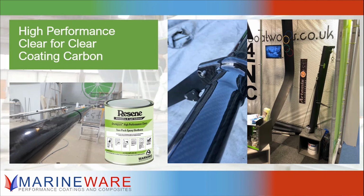I used to use that mixture of clear and primer to come up with a satin, but we now have a flattening agent for the clear coat itself. Have you used that, Pete? No. Oh, okay. It's the Ace Matte, which is a powdered flattening agent. We can mix it into the Durepox clear, and it's completely designed for clear coat flattening. It's very specific for clear coat flattening. So although you're putting a white powder in, you can now adjust the gloss just on the clear. Which is quite a useful tool, a new one to us actually.